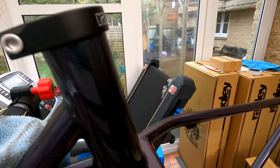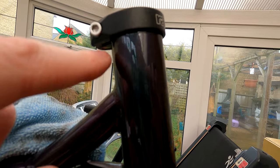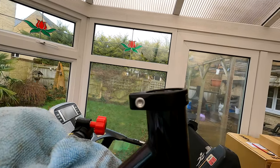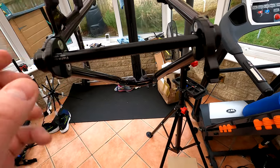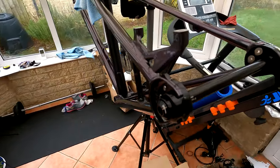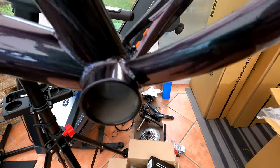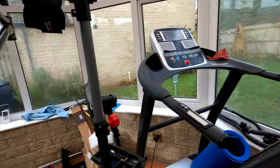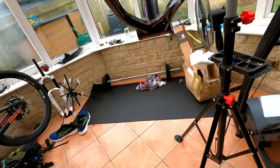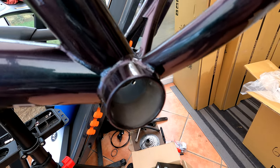The seat tube protection ends just as the clamp goes on, but it's much closer to the clamp, so it's probably a slightly better job — and you'd probably expect that as these frames cost twice as many of the aluminium ones. There's some axle fluff — this axle was covered in grease, weirdly the Mali one wasn't. This is the bottom bracket; it might need facing to be fair, depending on the type of bottom bracket you use. They haven't got a nice machine face though.